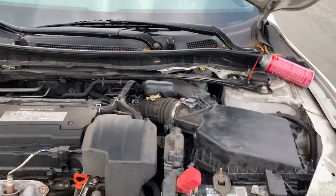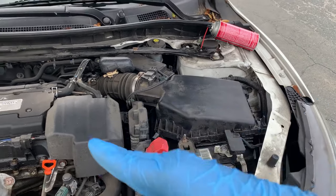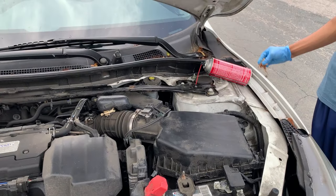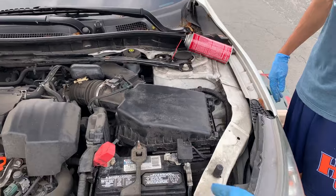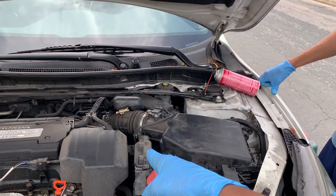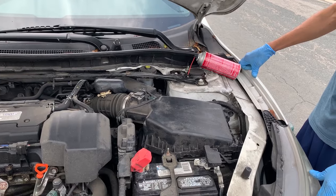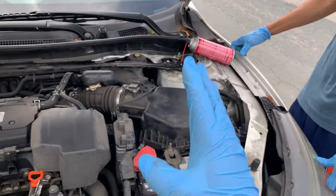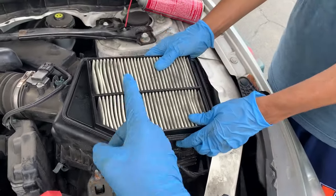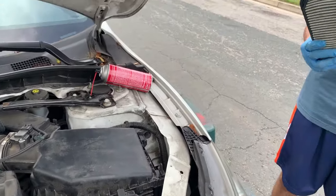The problem is resolved. If you have a Honda Accord and one day you go to start it, it starts and automatically shuts back off, and you get the same diagnostic code we received - try cleaning out your throttle body before doing any purchasing of hardware. However, do purchase a new intake air filter if yours is old.